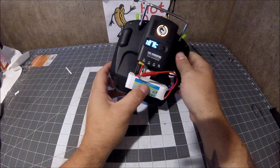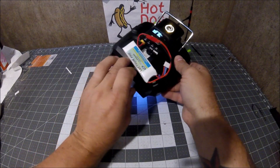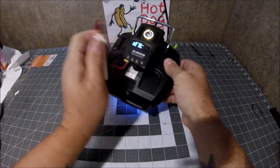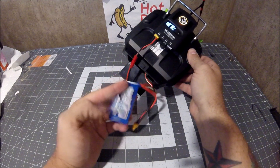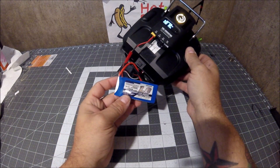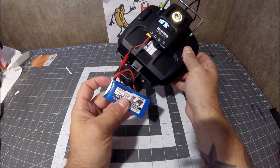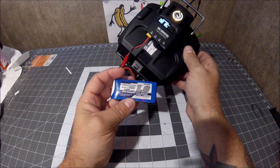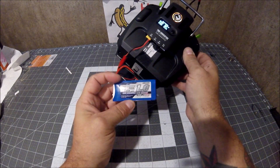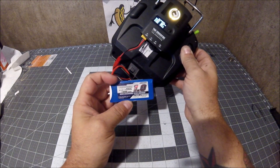It uses the full-size Crossfire. I use an Electron Pro 3S 950 milliamp to power my Crossfire, and then inside the transmitter I use a 1000 milliamp two-cell LiPo, which is the recommended two-cell. I'm going to do a quick run-through and show and prove that these things actually do have hall gimbal sensors, and then I'll show you how to adjust your gimbal tension.